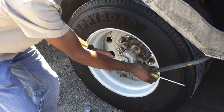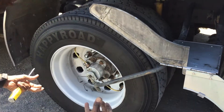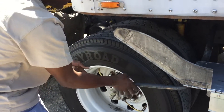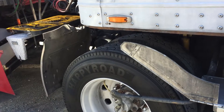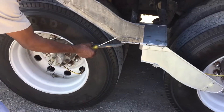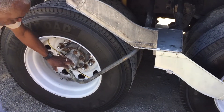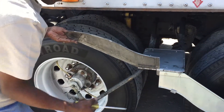Once you have the hose disconnected, you'll just wiggle this bar back and forth, pull it towards you and it'll go straight up and out of the way, and you'll just take your tire off. When you put it all back together you put it back in reverse — the arm will be down, you'll put your hose back on, connect it, and bring your bat wings down.